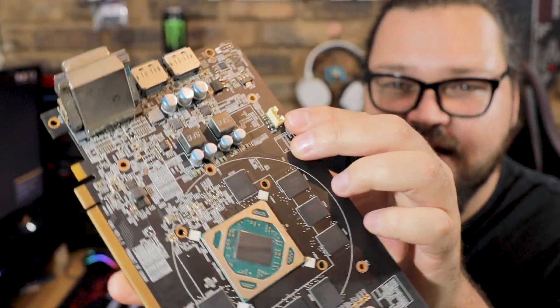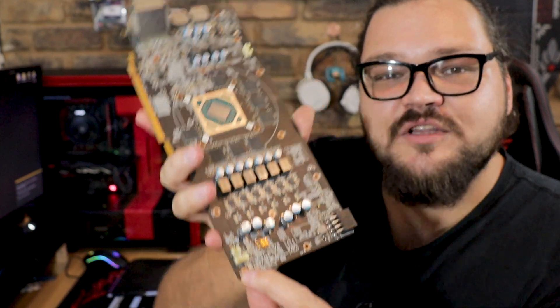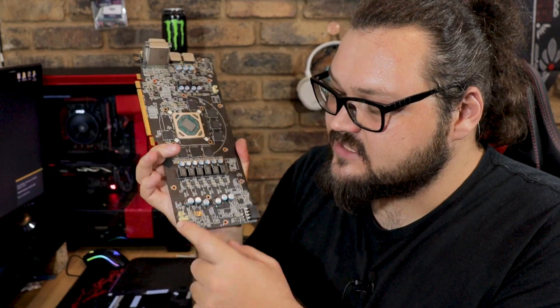It's been about an hour and a half, so safe to say this thing is as cool as it's gonna get. All that's left to do is put it back together and pop it into the system. One thing I noticed during the baking process was, along with that weird smell, these little connectors over here used to be white — they're a little discolored now. This is something I've seen before on other boards and PlayStations I've resurrected. It just gets a little discolored on the white plastic bits, but that shouldn't really affect the board working at all. So let's put this thing back together.